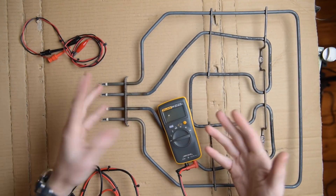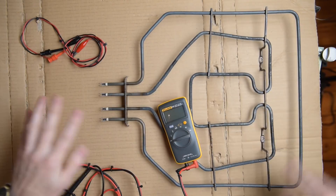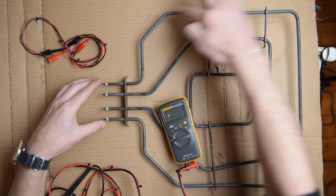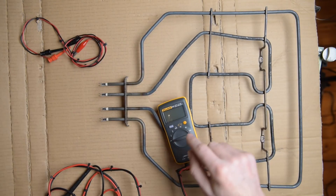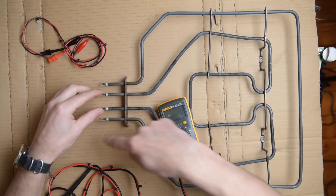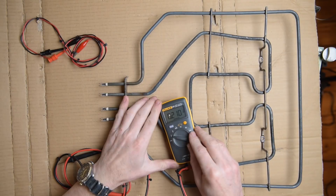I've got a cheap 40-pound Fluke multimeter — this is the one that I use. The element looks in okay condition to some degree. Essentially you've got one element that goes all the way around the outside, and then you've got a central one that does this section here. On this particular oven, to use the grill you would turn both of these on. It was only heating up on the outside element.